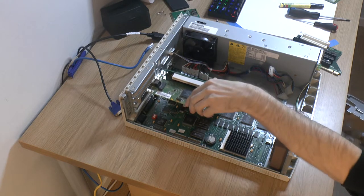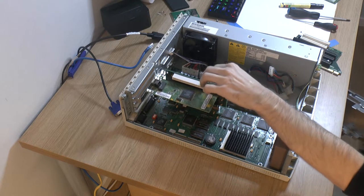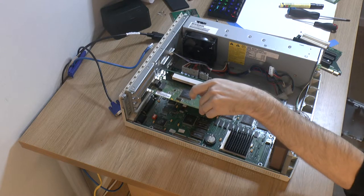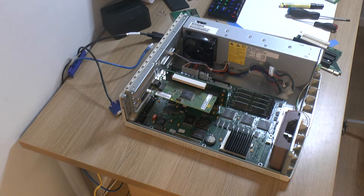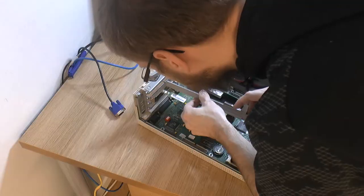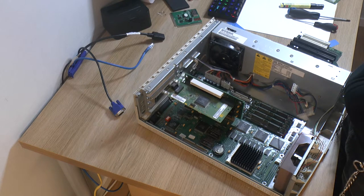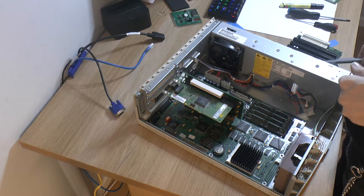The thing is, as long as you actually have a card or something screwed in and that sits there, you really don't need riser support that much. So it might not be a big deal. Yeah, it's exactly 50-50 split. So we can use that to figure out the height difference. I can see from the rear here that this card exactly ends up in the middle of two cards on the old riser. So something like that, that's 13.5 millimeters, so it's just above 1/2 inch is the depth difference.